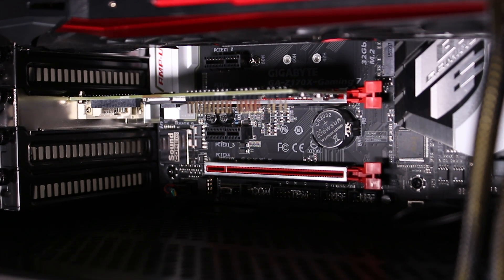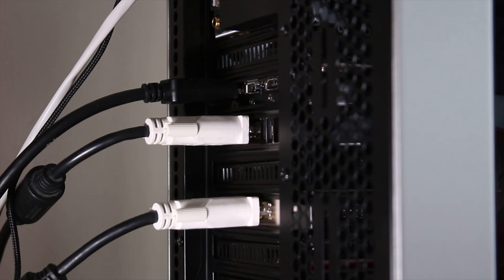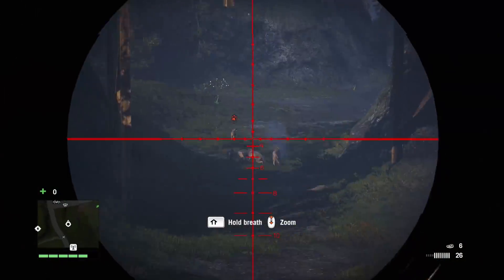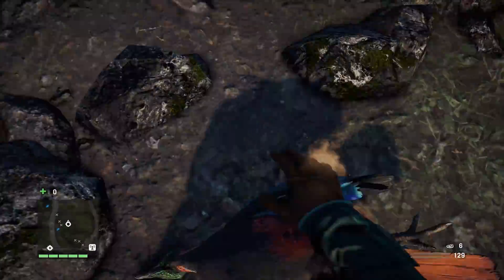Fitted inside a system it's not the prettiest thing in the world — I've certainly seen a few prettier models. But if you want to connect it, for example to record from the graphics card output, you basically just plug in a DVI cable, duplicate the screens, make sure they're both running at 60Hz, and then game away.